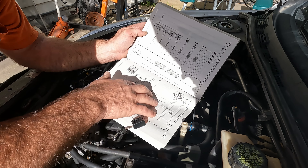Here's what we've got in our diagram, and we have to make sure that our polarities stay correct. It doesn't really matter who's who as long as we keep our pins straight. 12 volts comes in on the top here, and these coils get a ground from the PCM when they're intended to fire. As long as our wires go to the same pin left and right, we'll be good to go. This wire goes in the red and this wire goes in the black on all four of these.